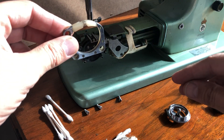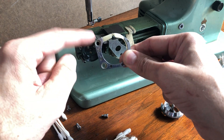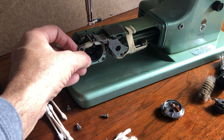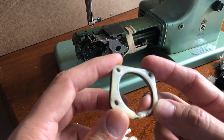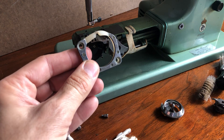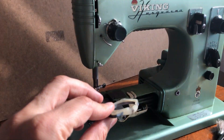These two were the bottom screws, and this screw was for the top left — it's only held in with three screws. I took those out carefully; they turned easily. Had they not, I would have waited and maybe added some oil to soften them up. This is a metal cover, and then there's a nylon piece in the back. The reason I still consider this an heirloom machine is that plastic is only used where there is no mechanical stress.